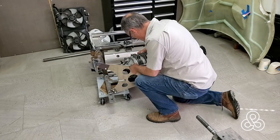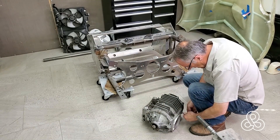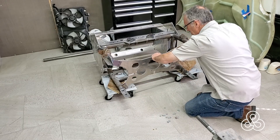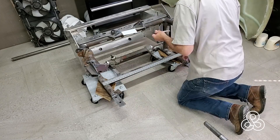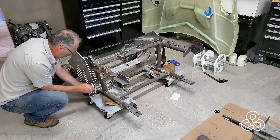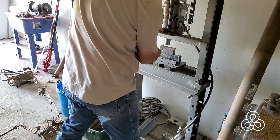To start off with, we're going to have to pull our differential out of the way and set it aside to work on at another time. Part of that is also that this adapter plate holding the main mount for this differential is going to have to come out. That has been modified to lower the differential. That lowering is going to cause a little bit of a problem — there's a cross member on the subframe that needs to be trimmed out and lowered because the differential is going to come right up against it, and we don't want that vibration of two metal pieces together.